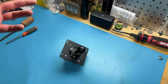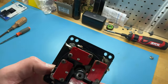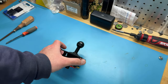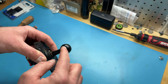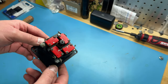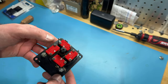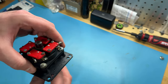I've got one right here that is in pretty decent shape — an original Q-Bert joystick. These were manufactured by STC Rotterdam; I think STC stood for Suzo Trading Company, before it became Suzo and then Suzo Hap — often called the Rotterdam joystick. This is sort of an unusual design: it's a short-throw joystick, meaning the shaft doesn't really move all that much. It's got a plastic ball top and a plastic sheath over the shaft. It's a microswitch joystick, which was kind of unusual for this time — that was more of a Japanese thing.